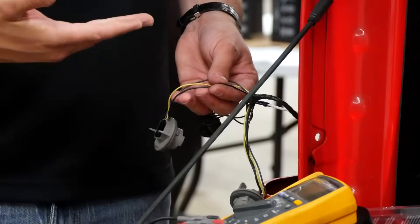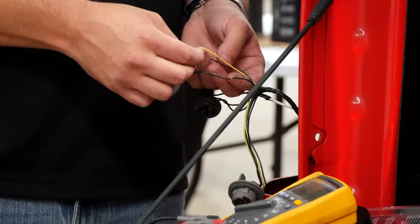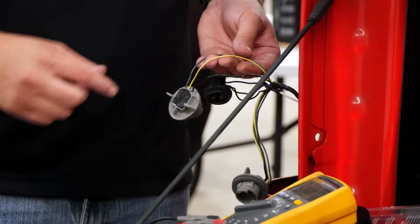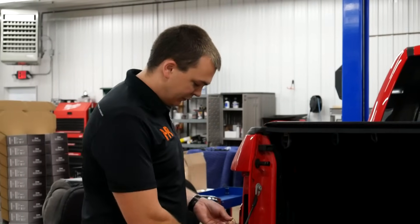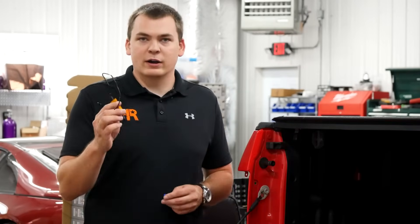So we now know that our outside pin — this black wire — is our ground. We know that the center wire is our parking light; we're going to leave that alone. And we know that this outside pin is our turn signal. I don't want you to pay attention to the wire color so much in this video because I'm working on a truck that you might not be working on. All that matters is the wire locations. Just like there are a few ways to test the wires and figure out what your turn signal and ground are, there are a few different ways you can connect this resistor to your wires.